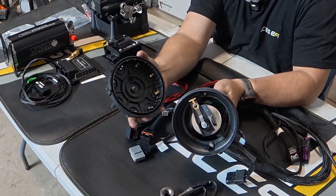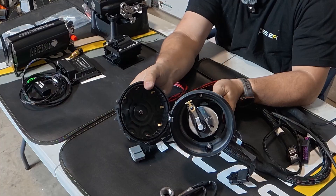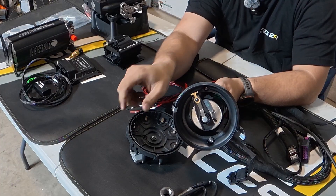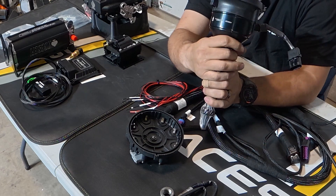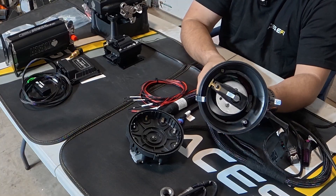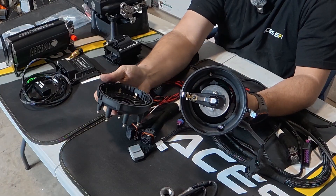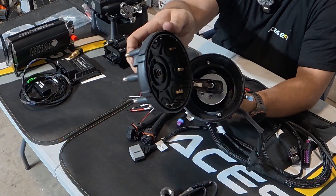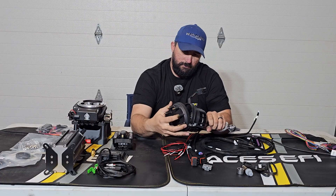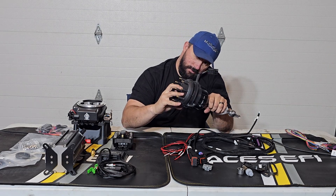So far I've seen three different styles of hold-downs for the caps. This one uses the side clamps. I've also seen ones that thread into the base and others that are quarter-turn lock with spring tension. It's a normal hall effect distributor with a 7-plus-1 reluctor wheel, so it can be used for multi-port setups as well — that's why I chose this over the magnetic pickup, because eventually that car will have multi-port and I want to make it easy to switch.